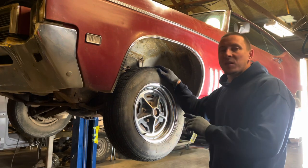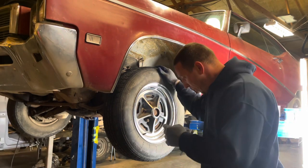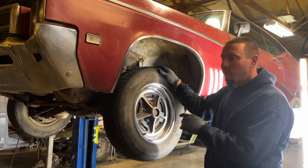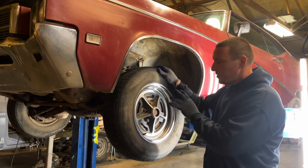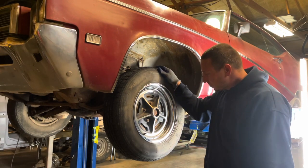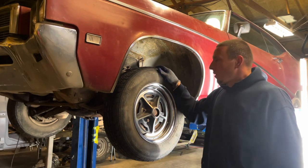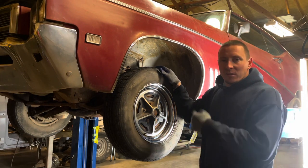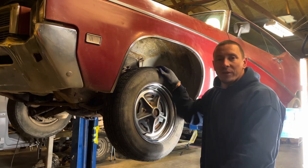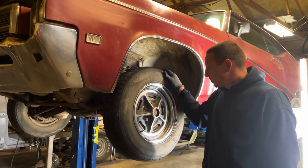So this is my intact side. When you're doing drum brakes, it's good to do one side at a time so that you can have a side to reference about how your springs and stuff go in there. Don't tear both sides apart at once. I've done this many, many times, and I still do it that way so I don't lose any springs or forget which way something went.